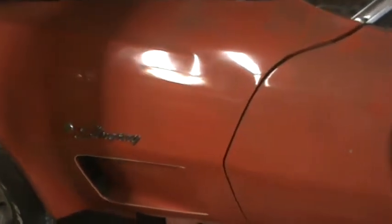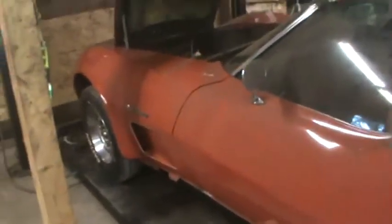go on my way. What this had was a delay. You had to open the door, and then there was a switch in. There's three storage compartments. Well, one's got a battery in it over here, and then there's two storage compartments. One was supposed to have a jack, which this car never had when I got it. But the middle one had a switch, and you had about 15-20 seconds before the alarm started to go off. So the first thing you did is open the door, throw the seat forward, reach back there and do the switch. But I don't want to do that. I want to do it through the key and have it so that I can unlock it before I get in, or unset the alarm before I get in.